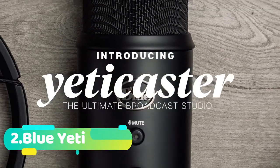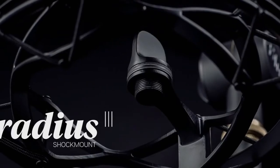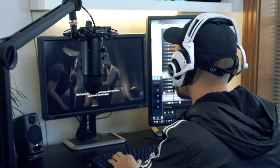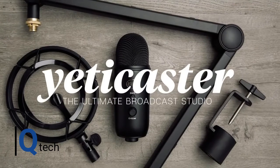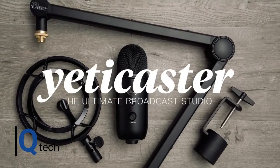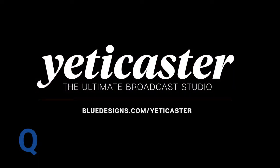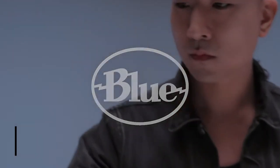Number 2 is the Blue Yeti USB Microphone. Interesting name for a microphone and it's more than an interesting mic. The Blue Yeti has been designed to be as flexible as possible. It is a tri-capsule array with three condenser elements, providing a selection of polar patterns — you can switch between omnidirectional, bi-directional, cardioid, and stereo. It will record your audio at 16-bit 48kHz. To ensure latency-free monitoring, it has an independent gain control and a headphone amp. The mic also has a mute and gain control, putting you in control of what is going on. If you are getting feedback or distortion while recording, you can just adjust the mic's gain control to reduce sensitivity. And it comes with a 3.5mm headphone jack which will let you listen to what is going on latency-free.